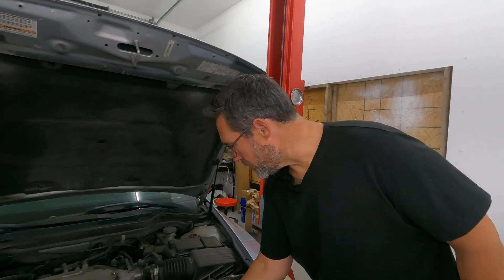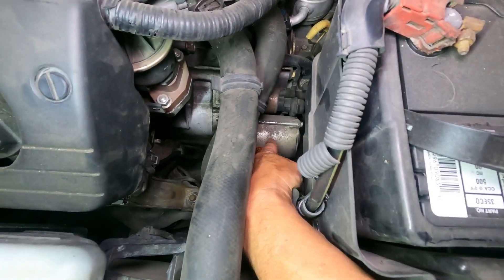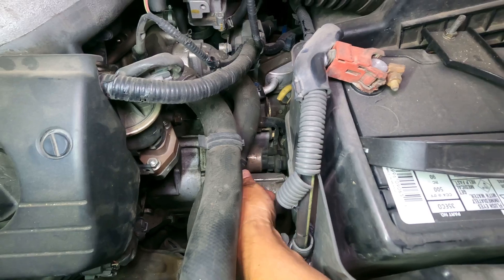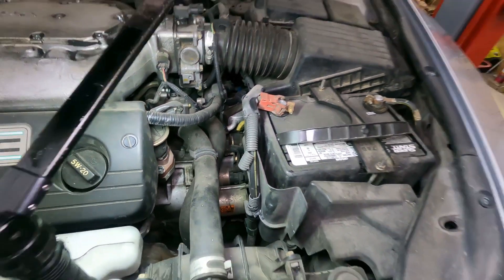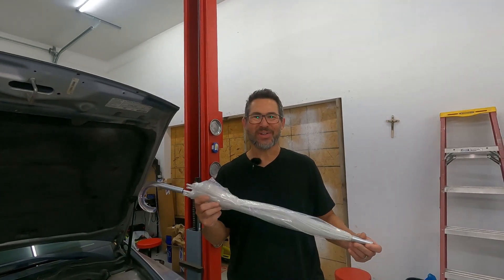On this particular car, the starter is located right down here — this is what turns over your engine. You'll have a big cylinder — that's the starter motor — and then oftentimes there's a small cylinder attached to the side of it, the solenoid. If you are trying to start your car and you hear a click, click, click whenever you turn that key, chances are that's the starter trying to engage but it can't. One of the reasons why that happens is because these starters work so hard, they make a lot of carbon dust from the brushes. Also, grease and grime can get inside and they get gummed up or sticky inside, so sometimes they just won't turn over. And that's where our friend the umbrella comes in handy.